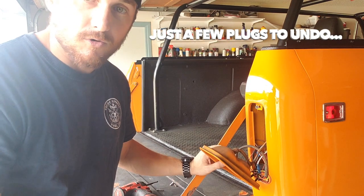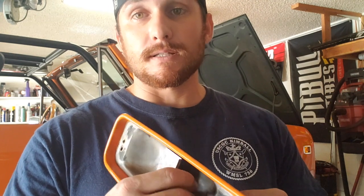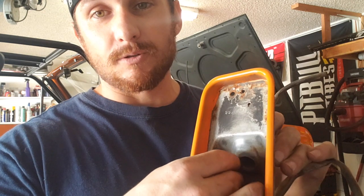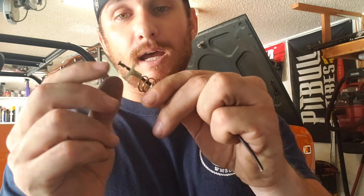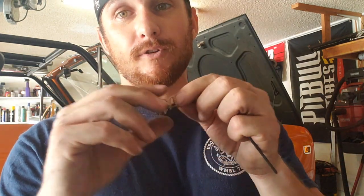Grab some stuff to disconnect in here, go through that and get the housing on the bench, switch out the wire. So we got the housings pulled off the truck. A couple things to note — it's not as easy as just pulling the wires out. You're going to have to de-pin your connectors or cut the connectors and do new ones, because the contact points that are inside the points of the light bulb have to slip through. What I did, I just cut this one because I already know I'll slip a new wire. You're going to pull it through — this one's for the reverse, it's just a single pull. So you're going to pull that out, your spring, your contact pad, and then a little point where your light bulb makes contact. Don't lose that spring — the spring is what gives you the ability for your light bulb to hold in there when you twist it. If you lose that spring, you're kind of screwed.